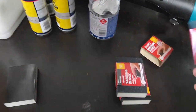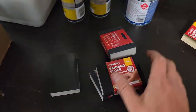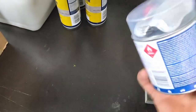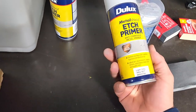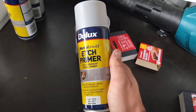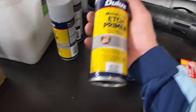So I was going to cut it off and throw it in the bin, but I like the look of it and I think it just needs to be perfected. From Bunnings, we ended up getting a bunch of sanding blocks — extra fine which is 400 grit, and 320 grit fine ones. We also got some metal bog from Bunnings, just in case we need to patch up a couple of little holes. And then some more etch primer — Metal Shield. I've used it on all the machines I've ever worked on and it works reasonably well. We're not going to use this as the paint primer — this is just to stop it rusting. When we go to paint it, we'll use a proper primer out of a gun, probably a 2K primer to harden it up.